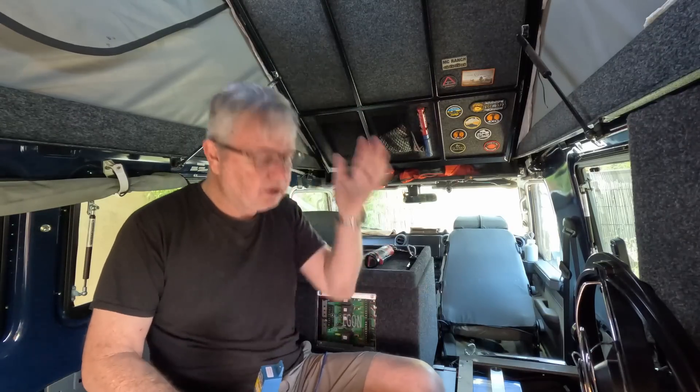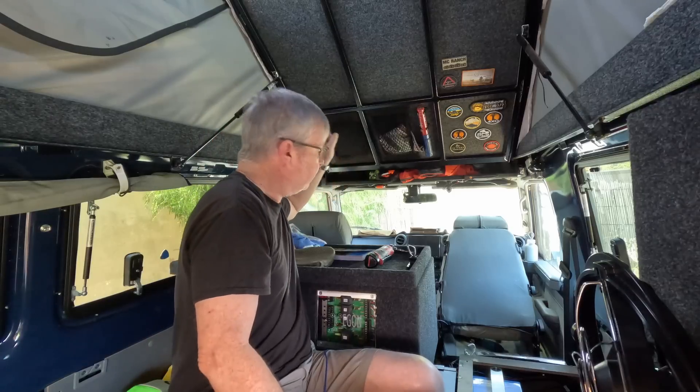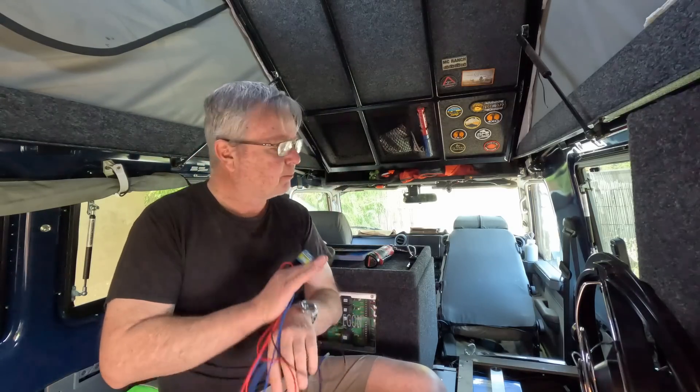More and more people are discovering this. I did a video about it three years ago and I've never received such hate and vitriol on YouTube in my life. What I had discovered was something little known — it's now quite well known. The solution is so unbelievably simple: charge your auxiliary batteries first. Once they're fully charged, they don't need more charge and won't steal charge from the start battery. Charge them first — problem solved.